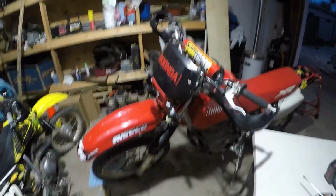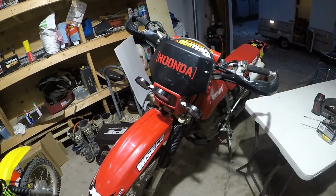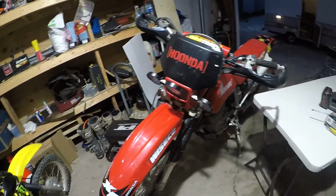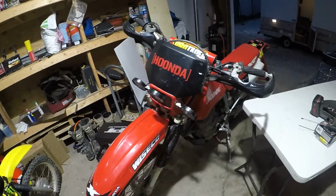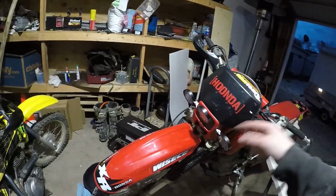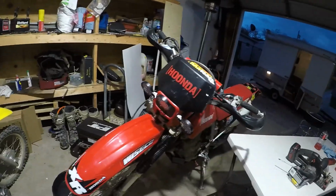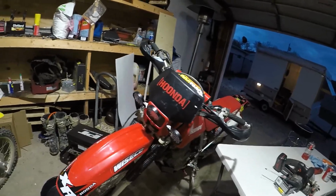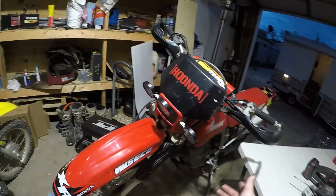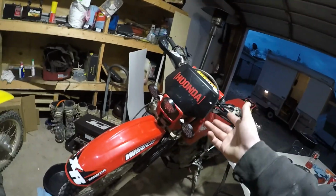So anyway, I saw some pretty inaccurate information online from some people on forums, like really old forums, and even on Facebook. Someone was like, yeah, you can't do LEDs off of it because it's on AC and LEDs don't like to flash. Well, they actually don't care about flashing. What they care about is VR, which is the reverse voltage through the diode, because when it's alternating, it sends current back, and when it sends voltage back, if that exceeds the VR for the LED, the diode, then it will overheat and eventually burn out.